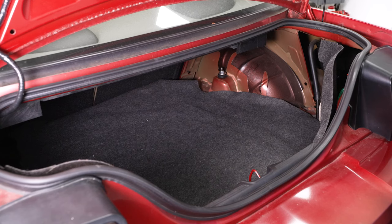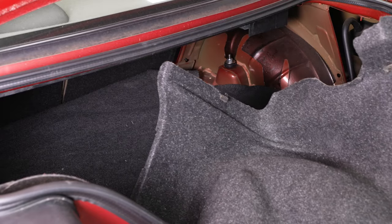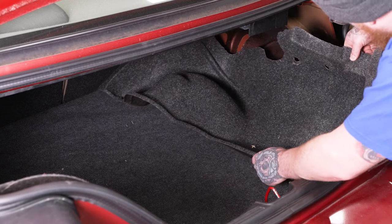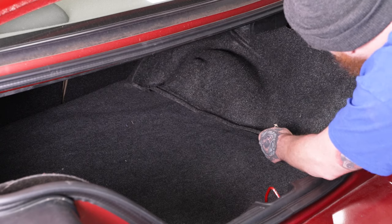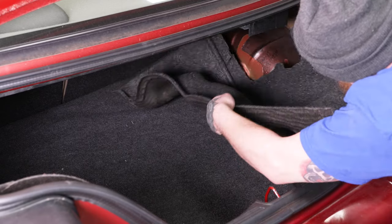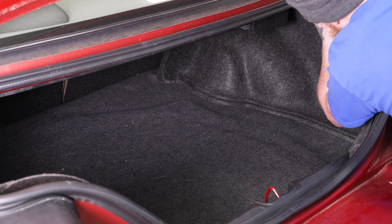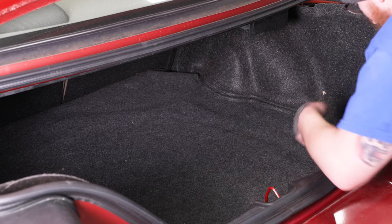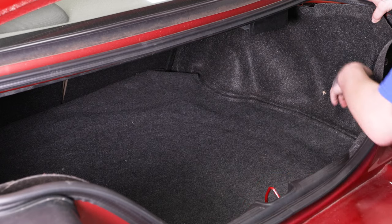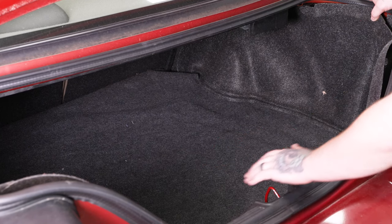Once you've got this process complete on this side, repeat these same steps on the other side. Then reinstall the trunk liner — get the car back up in the air and button everything else down. Reassemble the trunk liner pieces, slide the insert panel in — it can be a little tricky — and line up the hand screws, make sure it's seated. Reattach the hinge panel with the four push pins previously shown.